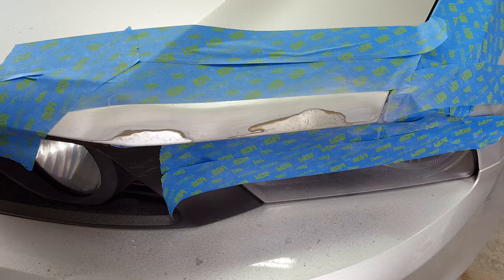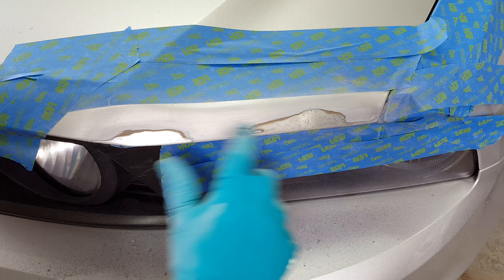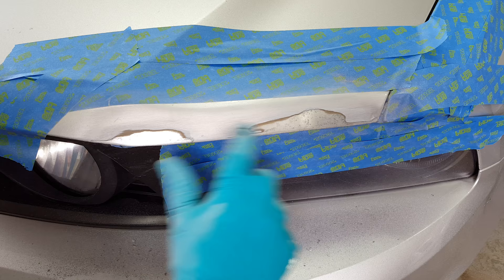As you can see, we're about finished with the 80 grit. We've worked everything back — you can see where the corrosion is in here. If you had really deep pitting, you could touch that up with spot and glazing putty or a similar product. But for me, we're just gonna keep sanding.